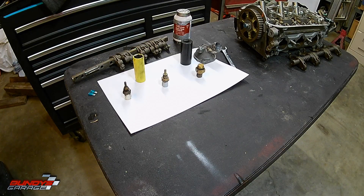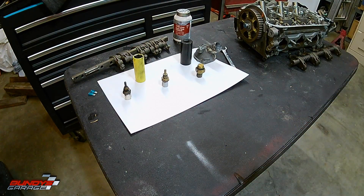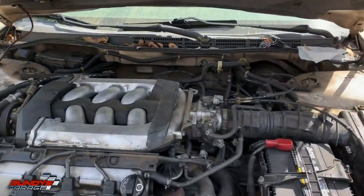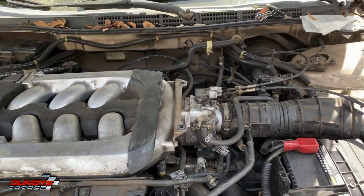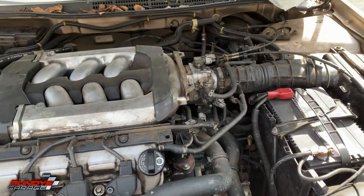You're going to get a check engine light for misfire, but it's not really a misfire. It's misleading because the knock sensor can't detect that it's actually not a misfire — it just sees that the engine is shaking and throws a misfire code. It could be any of the P0300s or even a random cylinder misfire. Don't let that throw you off. It's not the gas, because if it had anything to do with winter gas, it would have happened a long, long time ago.